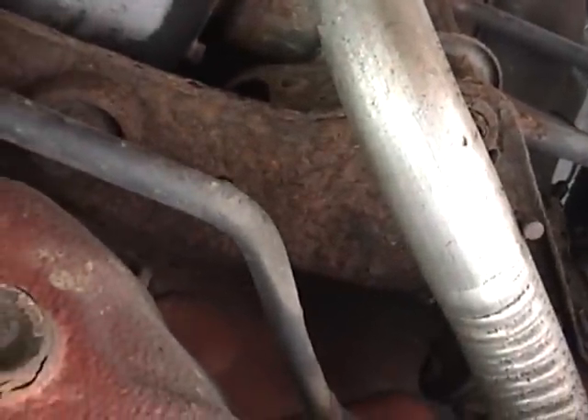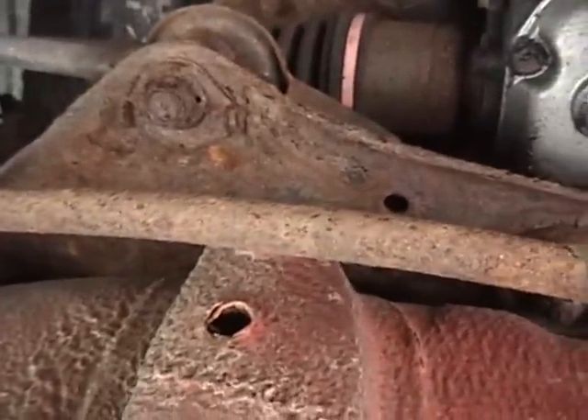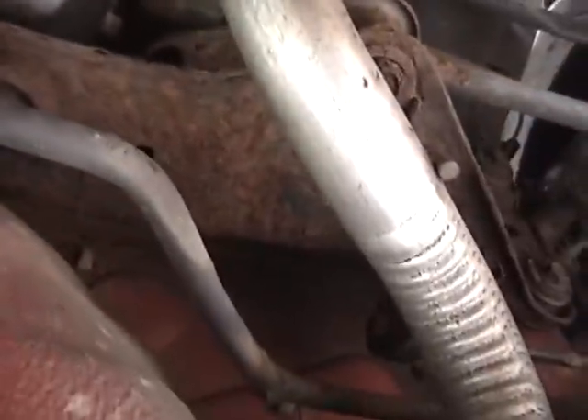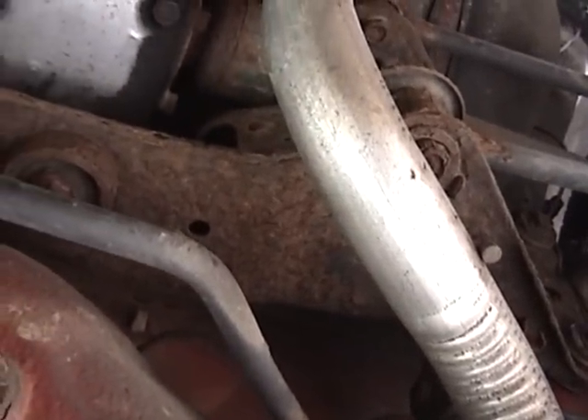But what I'm actually more concerned about — I'm getting on the ground here — right down here under the car, you can see the rear suspension carrier, which is all sorts of nasty. There was really no way I could check this out before I bought the car, and obviously it does need attention. These do rust out, so what I'm going to do is take a wire brush to this by hand as best I can, then clean it up and coat it with Miracle Paint, which should definitely buy me some more time, perhaps a couple more years with this.